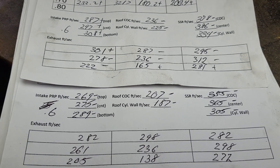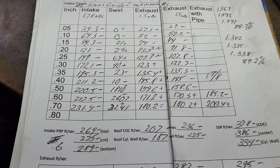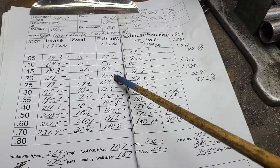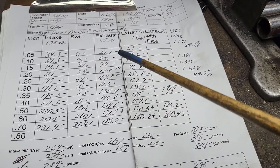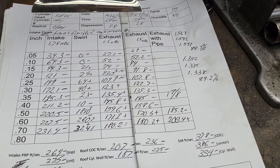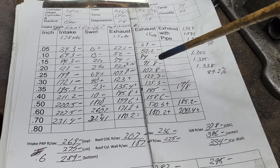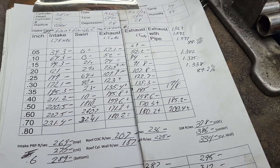Let's take a look at the exhaust. All I did was give it a little bit of a cleanup and a touch of a radius on the top. For those couple of minutes worth of work, we actually got a couple of gains — not huge, nothing is big. We lost a little at low lifts, but I couldn't care less anyway. We got a little noise here and here, but we got more flow. You would think the noise would cost you CFM, but not necessarily on an exhaust. Overall it's up a little, tiny bit up across several lift points — so it's not a complete loser.